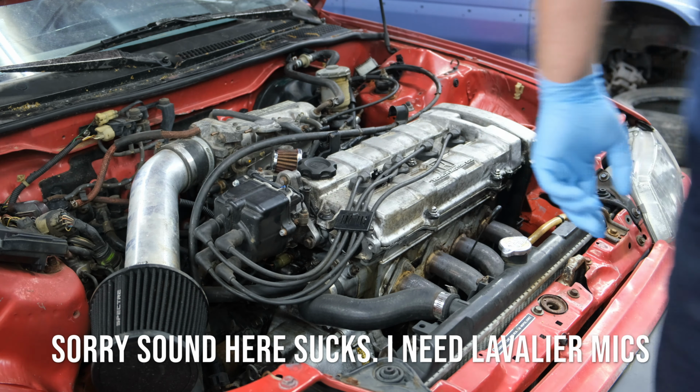So I'll take this back off. And we need to check the ohms, the resistance in the wire. So we need to check the wiring on here. And look at that. We have a wire that's not in. Well, that was an end. So I'm going to make sure this wasn't depinned or something funky, and then go from there.